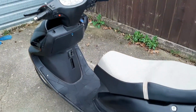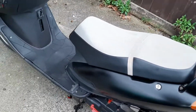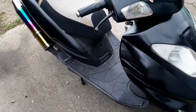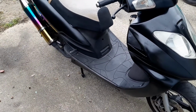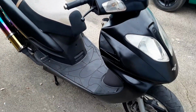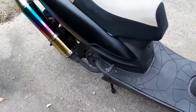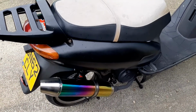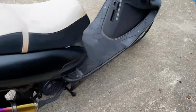So yeah, I did pull the top end apart just to make sure it wasn't leaking, and I think the torque specs were all a bit off, so that all got done. I checked the valve clearances whilst I was there. Put everything back together, brand new everything on it. Buttoned it up, good as gold. Yeah, I think that's near on everything.